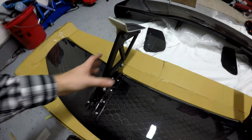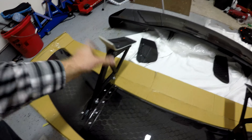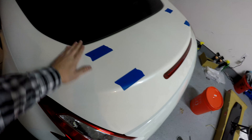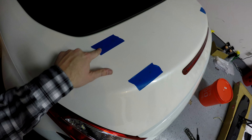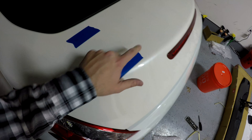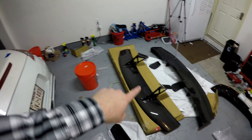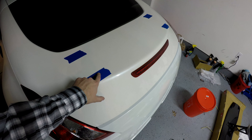Now I've got the other pieces attached, including the stands and the feet. It's important to get these as secure as possible when pre-assembling the spoiler, so that way you know where the feet are going to sit on top of the car. The next thing you'll want to do is put down some masking tape — several strips across the area where you plan on the stands sitting. We're going to take the spoiler and test fit it on top of the hatch.